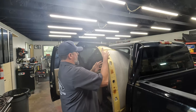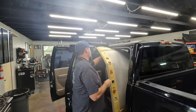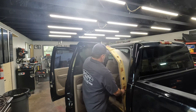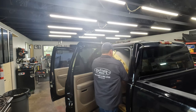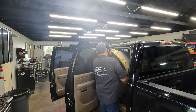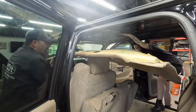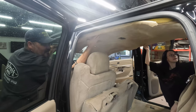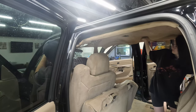Start to wrap around the seat to your right, because otherwise we'll just end up out the other doorway and that doesn't help anybody. That goes up, right above the mirror. I caught on something — there we go. Keep your left end down, go back down a little bit. So now that we got it in — unfortunately the audio got corrupted here, which is unfortunate because my daughter was super hilarious in this whole process. Anyway, we're getting it up in and over top of the back trim pieces. Remember from the earlier video, we didn't pull the trim all the way off — we just pulled it loose so we can slide it out, then line it up everywhere else and get it pushed up into the ceiling.